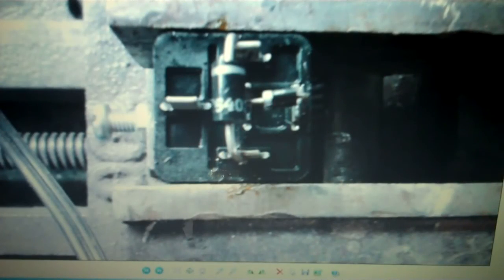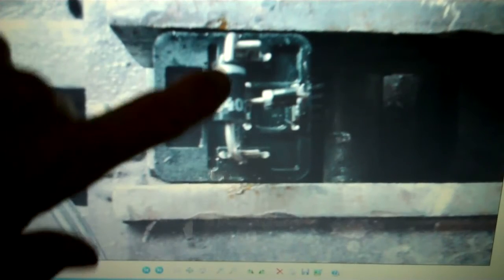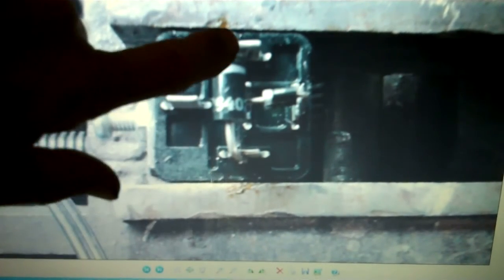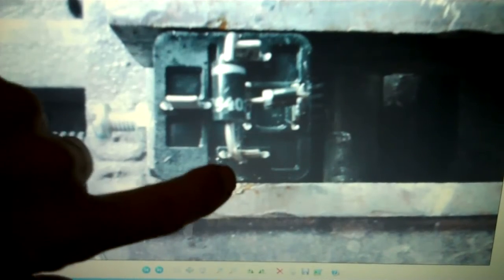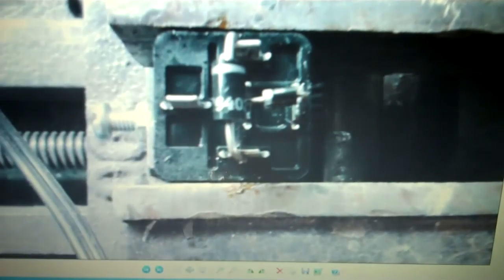This is just a photograph of the diode box with the cover off, sitting in a vise because I'm about to remove the diodes. You can see the bigger diode is just soldered from this pin to this pin, and the little diode is soldered on this pin. There's a pin in the center here underneath the big one. So one diode, two diodes — that's all that was in there. Just remove those, put the new ones in, solder them in, and that was that.